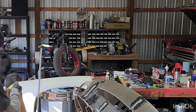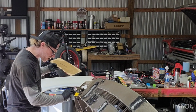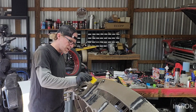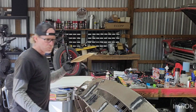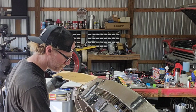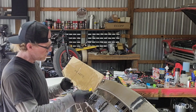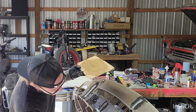And then use your adhesion promoter on the front side after you grind in a groove and feather it out as far as you can, to use this stuff in, fill it in. Then you can sand it, feather everything in, put a nice good coat of primer on there, and then get yourself a can of wrinkle paint and go to town. Put two or three good coats on it. Let it sit for about a day. Come back, and you can't even tell.